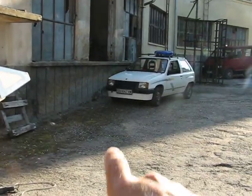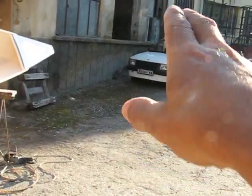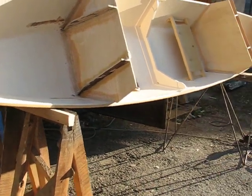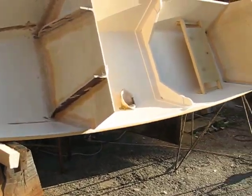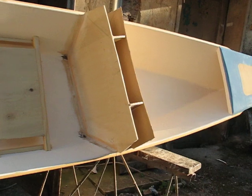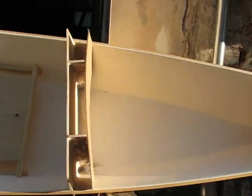There's our workhorse — we built boats for him, we need boats to go on him. We need light boats, simple boats. It's all plywood, it's all poplar, and poplar is strong and good stuff. I think poplar ply is — okume marine is not more rot resistant than poplar ply. Okume has very low rot resistance and I don't know why everybody goes on about okume when poplar ply is almost the same rot resistance. Here at Barganship Yards we build with poplar ply — you come out with a lighter boat, a stronger boat, and definitely a cheaper one.